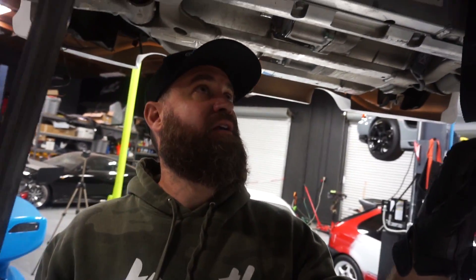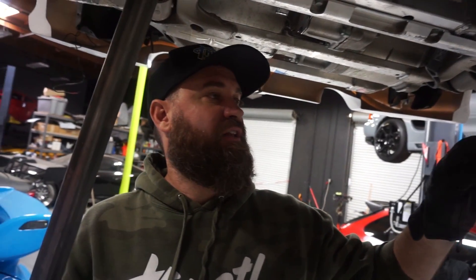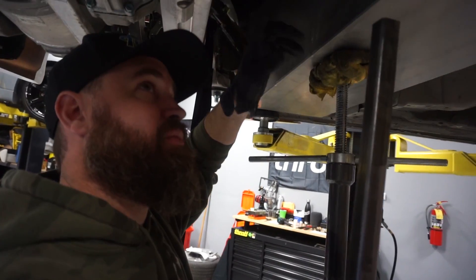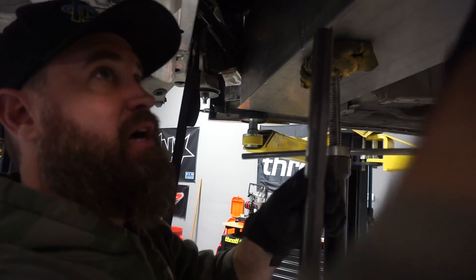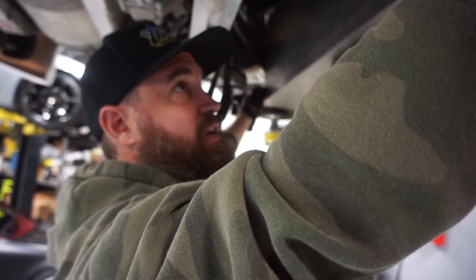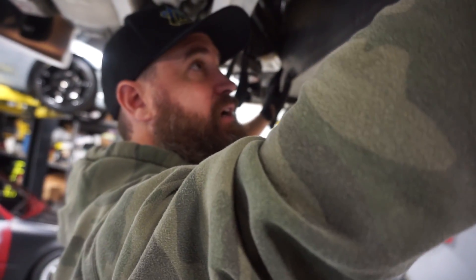Looks like you've been busy. Well, I've got a tab mounted on the front, so the front is now located. But now I've got to get the back figured out. I think we discussed running some sort of heavy tubing or square stock between our unibody reinforcement that we did. I'm going to use these as our landing points for this one-by-one square stock. I'm going to bevel the edge so that it mates against these two plates, and it's going to run along — probably with about an eighth-inch gap behind the box all the way across — which will give us some support left to right in the chassis.